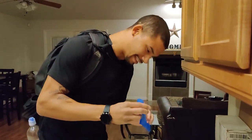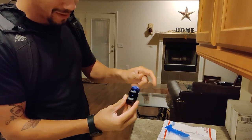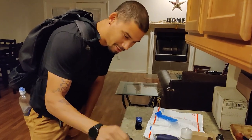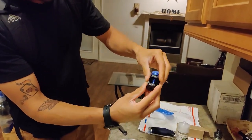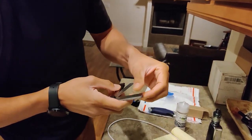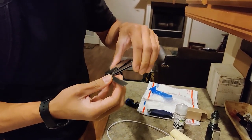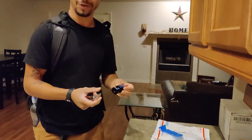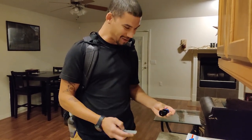You guys obviously are not seeing what I'm seeing. It's a spark plug gap tool, which is super convenient because I'm always tapping my spark plugs on the ground. Your spark plug goes in there and you use this side and it presses it down. As you're pressing it down, you got your feeler gauge here. I do 0.032, so this is close enough — 0.03. You'll put your spark plug in there and press it down until you get the gap that you want. That makes life so convenient. That is so cool.